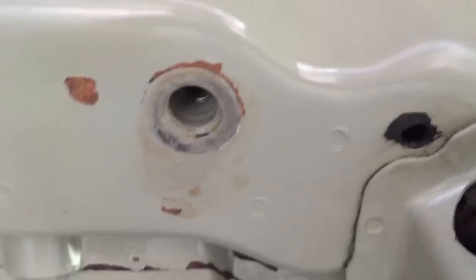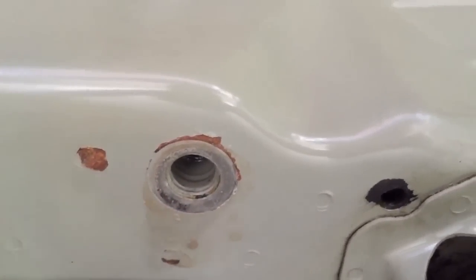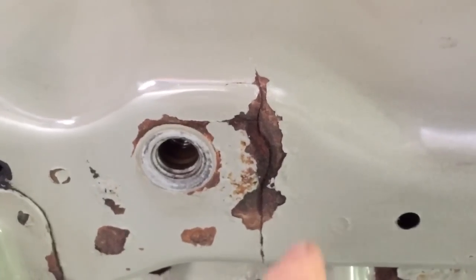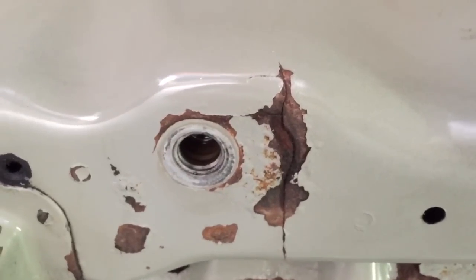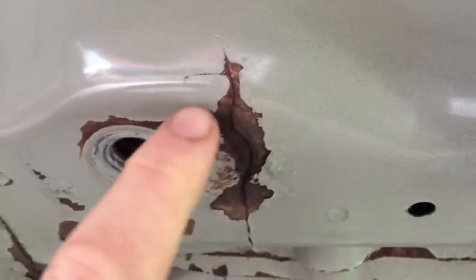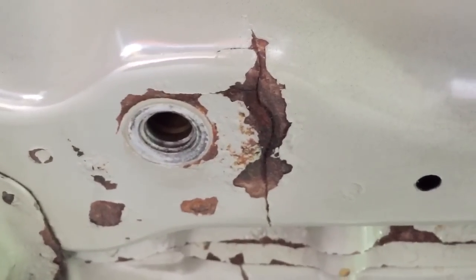And that's the look at the left front plate, the underside of it. A semicircular crack around the mounting point. A couple of little flexes on the spot welds. Right front, which has definitely got some damage. Good crack going all the way through the horizontal section, if you're looking at it like that, and also at the vertical. And then a couple of cracks coming in, and then definitely going around the mounting pin in the middle. And then various spot welds that have shown signs of flex.